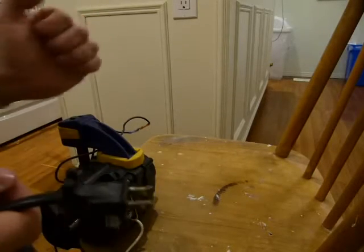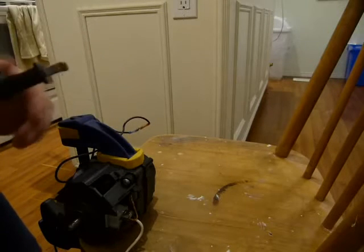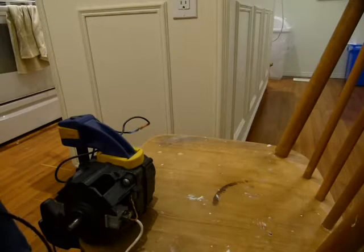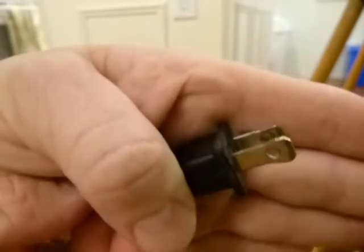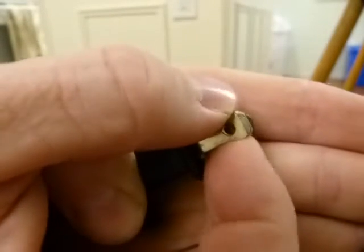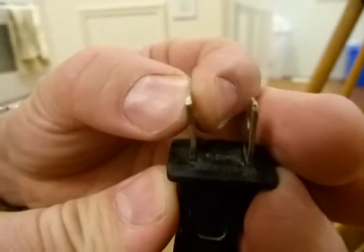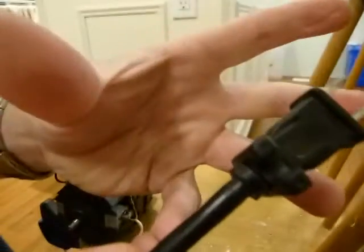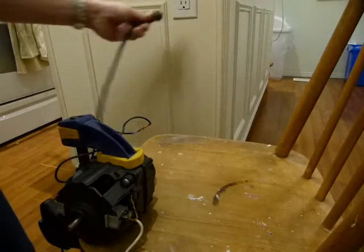After some experimentation with the motor, I found the cause of the problem — because sometimes the motor was on, sometimes it just doesn't want to work. The problem is here with the neutral pin. The neutral pin is this wider one at the plug, and look at this — it's got a loose pin or a loose tooth. It shouldn't wobble like that, and it also has a lot of excessive sideways play. So this pin is basically broken inside. I have to cut it off somewhere here and put a new plug on — super straightforward — but this is what's causing the malfunction.